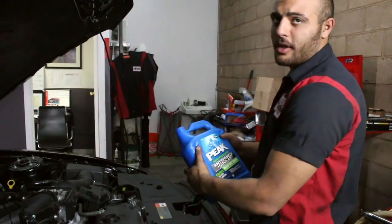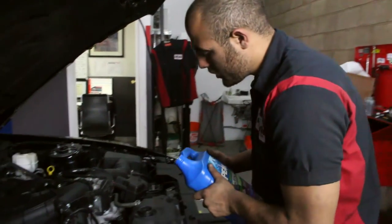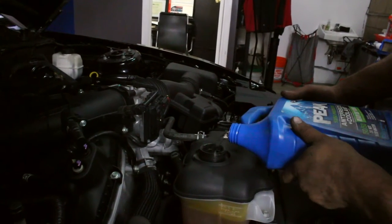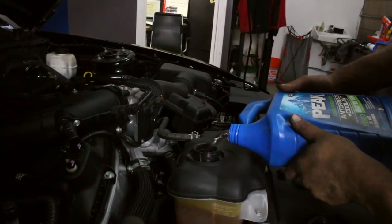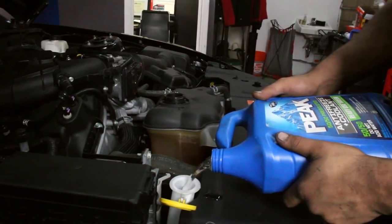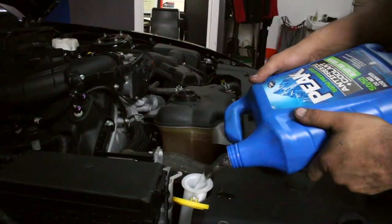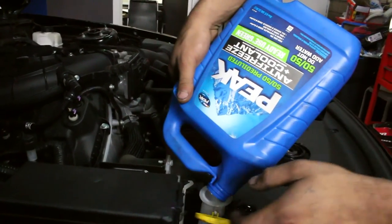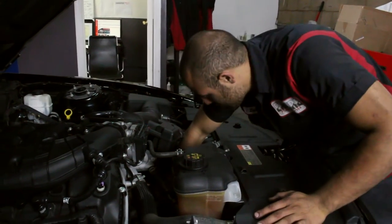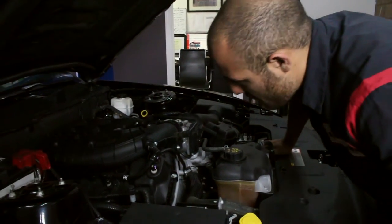You might be wondering why we're putting in coolant — it's actually just water. We're topping off all the fluids, just a little add-on to the top. I've flushed this out many times so it's completely 100% water in here. Right over here we're checking the windshield wiper fluid and adding some water to that too — right up to the top. You also want to look at the belts for any looseness or cracking — you can see this one is in good condition. And check up here for any leaks, possibly from the valve covers.